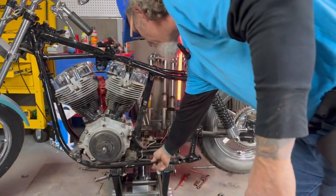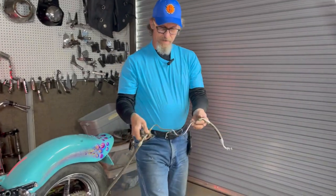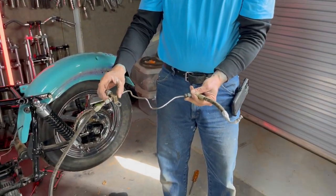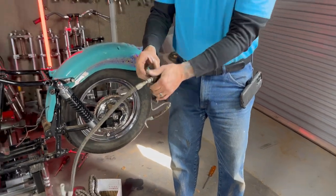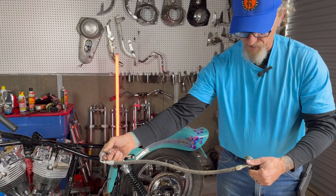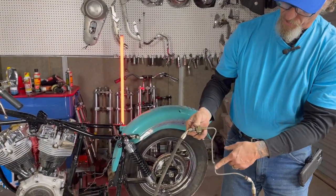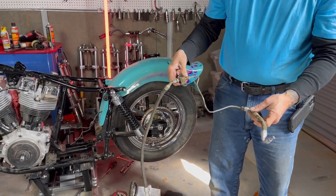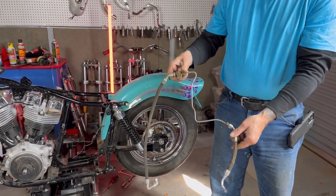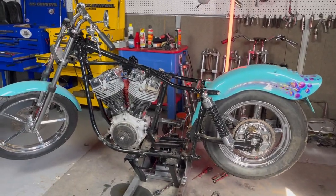So there's that brake line that I've been playing with. To find that brake line with all of those bends - it will meander its way under the transmission and mount where it needs to mount. It has the brake light switch and the forward tie to your master cylinder. You can find aftermarket, but they don't fit right. It's that steel line that's tough to get. A lot of people will just run newer rubber lines, which is fine. It's kind of cool to have stock parts whenever you can, so I save anything that's stock.